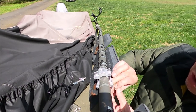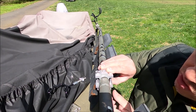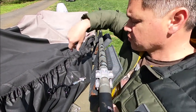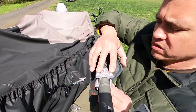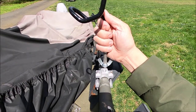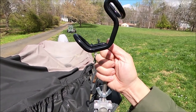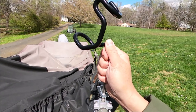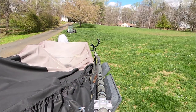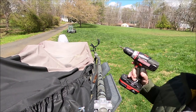And then once we do this, we're going to check to see what the angle of the rod is going to be, because you can buy 0 degrees, 33 degrees, 45, 90s, whatever. Just keep that hand tight right there for now. So this is going to be in like this. That's pretty good. Nice angle to it. Don't tighten this baby up. Looks like it takes a 7/16 closed wrench on this end here.